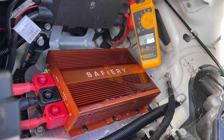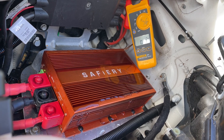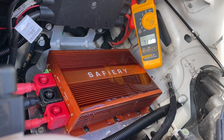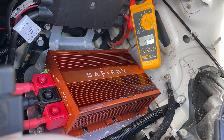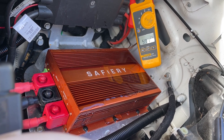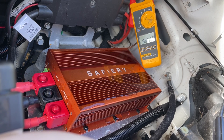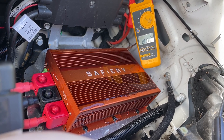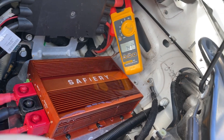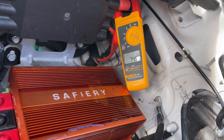Let's start up. So after we start up, we've got a time delay waiting for the smart alternator to bed itself down, and then once we get to voltage the little LED — you'll see it flash once and it'll actually go solid red. As it starts up, it's still getting the smart alternator to kick in, and now it's fully kicked in. And there it is — we're getting 74.7 amps out of it right now.